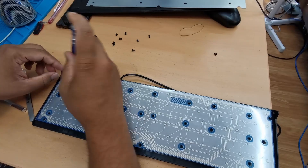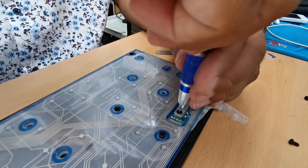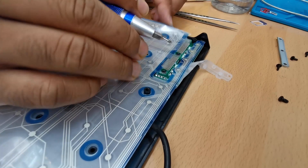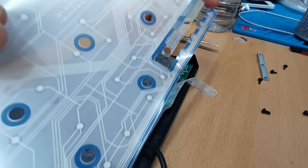That's why most cheap Chinese keyboards are not fixable, or very difficult to get access into for fixing. The screws are different. As you can see there are some flex cables — this one connects to the actual motherboard without soldering. If you buy a cheap one, it might be soldered in, making it very difficult to remove. Take it out with the soft pad carefully.